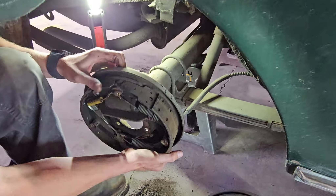We're going to hose these down with a little bit of brake cleaner just in case there's any grease on your brakes. Now we're going to get some fluid in this thing and bleed the brakes. Normally you would bench bleed your master cylinder, but we're going to do this the old-fashioned way. The instructions don't specify what brake fluid to use, but we're going to use DOT 3. We're pumping the brakes to get all the air out. We've already bled the rear brakes and now we're on to the front. We got a guy in the car pumping them manually — and that fluid looks nice and clear. We went around the car a few times to make sure all the air is out.